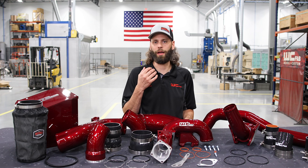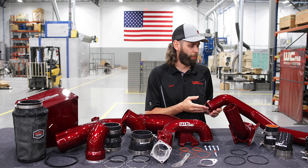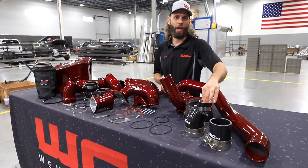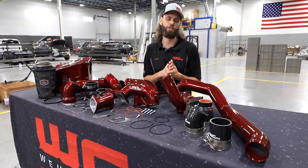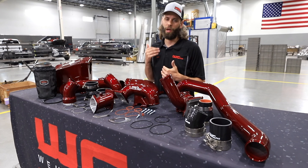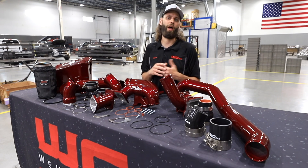From there, through the turbocharger — whether you're running an OEM turbocharger or an upgraded VGT unit, it's compatible with either one — we then go to our high flow three inch driver side intercooler pipe. This unit replaces the OEM two and a half inch intercooler pipe and most importantly upgrades the boot connection at the turbo outlet. The turbo outlet sees the highest temperatures of the whole intercooling system, and the OEM boot on the driver side pipe is one of the number one failure components on the LBZ LMM Duramax. The OEM boot uses a reverse style bead roll connection which is notorious for blowing off even on stock applications at stock boost levels — and it's even worse with towing, mountain grades, or upgraded tuning.